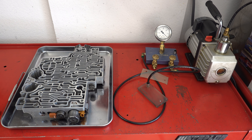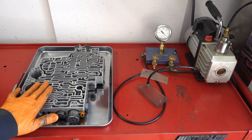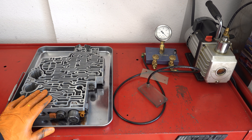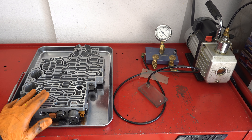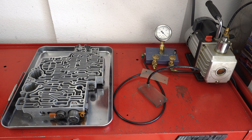In this video I'm going to test the 4L-80E valve body, specifically the actuator feed limit valve. 4L-80Es have kind of a bad problem with respect to bore wear in the AFL circuit. This valve likes to wear out, especially when the unit's over 100,000 or maybe 125,000 miles. It's always best to check them, because a lot of problems — both drivability issues as well as internal failures — can be traced to a worn AFL valve.